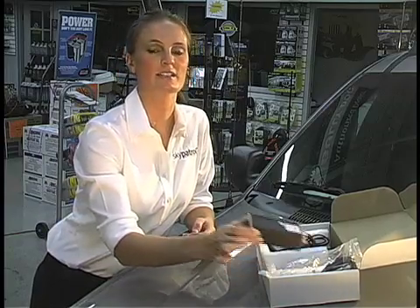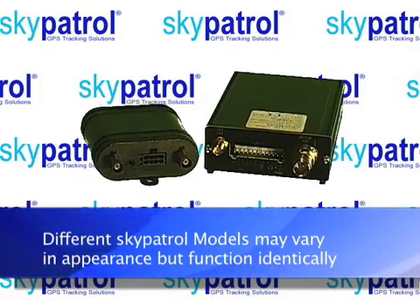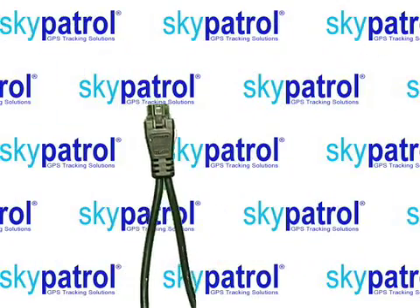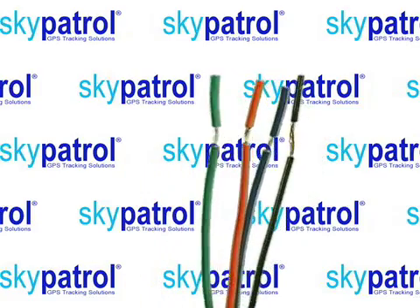First, check the Sky Patrol box and identify its contents. This small black box is the main part of the system and contains the GPS receiver and the outbound cellular modem for communicating with the Sky Patrol operations center. It needs to be installed in the passenger compartment or some other place where it is protected from the weather. Next, we have the wiring harness with an attached connector used to connect the Sky Patrol unit to your vehicle's electrical system. The wiring harness has two cables: one contains the three wires — black, white, and red — used to power the Sky Patrol transponder, and the other contains wires for optional alarm inputs and a control output. Since we're not hooking up any alarms on this install, I'm just going to leave the alarm cable bundled up close to the control unit.